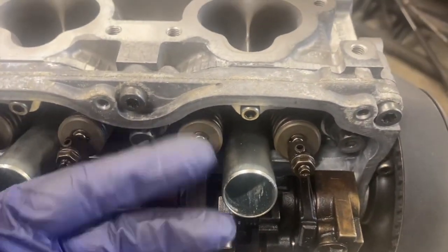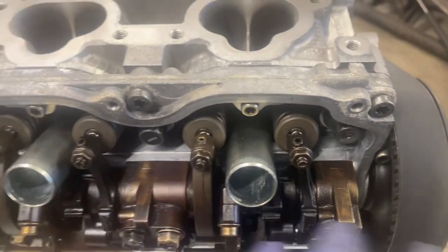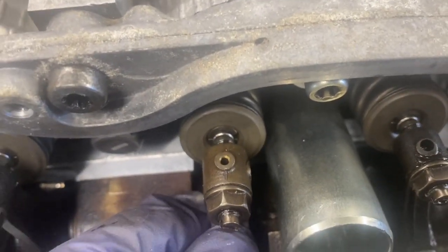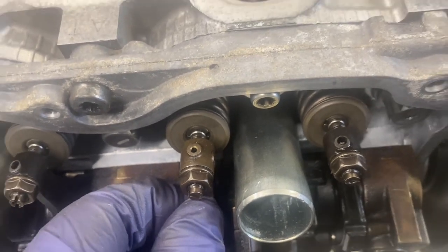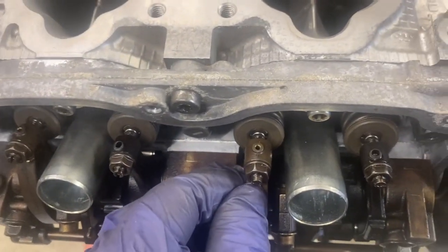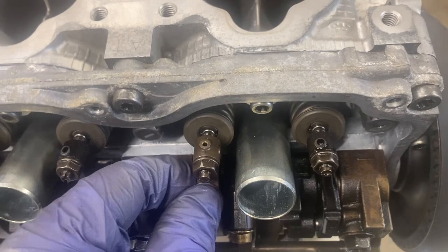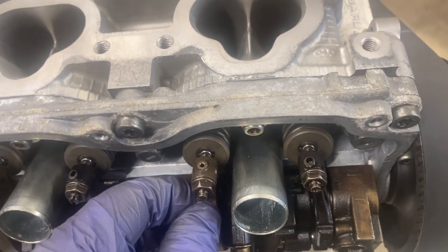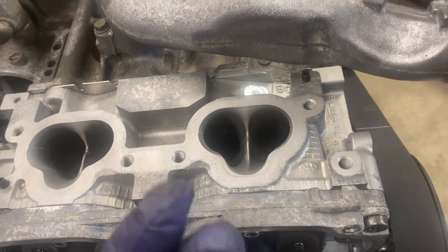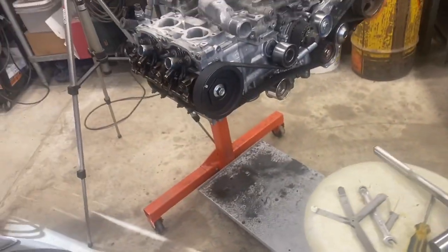This rocker arm just rocks back and forth, super fast. And as temperatures change and as things wear, you don't want it to bind and be tight. You want a little tiny bit of a gap in there, and that gap is critical. If that gap is set too small as the engine warms up, this rocker arm will go tight, which will allow that valve to never fully close, which will make the engine not perform well, and probably, I think, the valve overheats because it's not touching the aluminum cylinder head, which allows it to dissipate heat, and can cause lots of problems. So, setting the valve lash is normal maintenance.